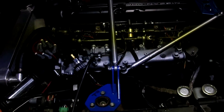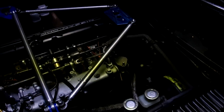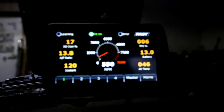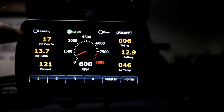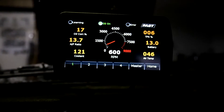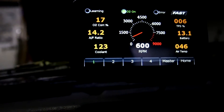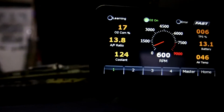I'm going to start it up now and show you how it runs. There it is running on the new system — you can see it's pretty smooth. The ECU starts learning when the temp gets to 140. As you can see we're at 120 right now. There's a little indicator up here that says 'learning' — that will light up green, and that's when the ECU will start tuning itself and self-learning. I like to keep the handheld on there because it shows you all the info. You just need to set everything up first, then you don't need it anymore, but I like to keep it.